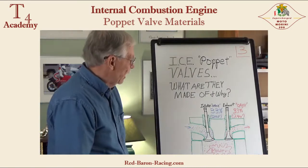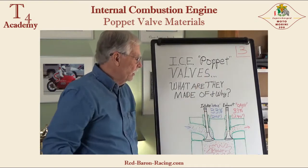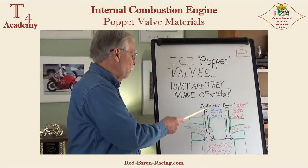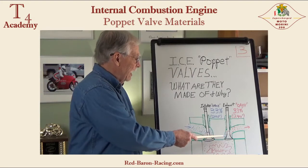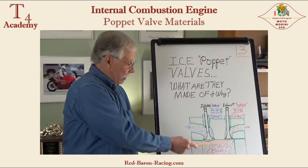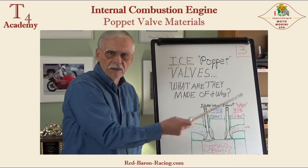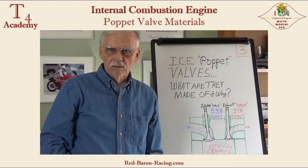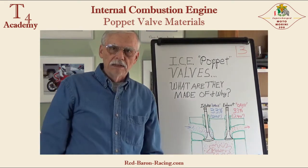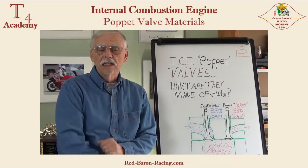Now, if we have a single profile cam in the engine, we'll have the same number of degrees on the exhaust. However, the reciprocal happens over here. For the intake it's blast cooled; for the exhaust it's blast heated. One-third of the time the exhaust valve opens, and this dragon breath goes screaming past it, heating the neck, the face, the valve — everything. It can glow red hot in really high-power applications. So one-third of the time this thing is getting blast heated. It only cools when it shuts and tries to shed some heat before the next heating cycle comes around.